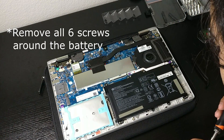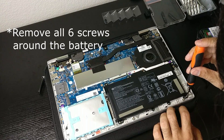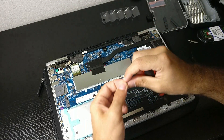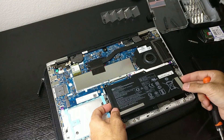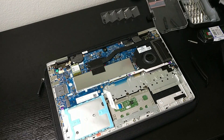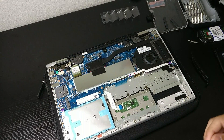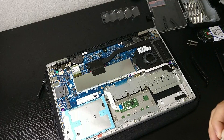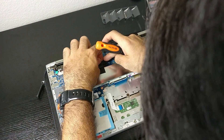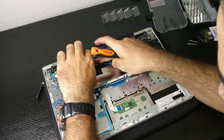We're going to start by taking the battery off. We need a smaller screw bit. We got all the screws out. Now we can pull the battery out very carefully. This is the battery — normal battery. Now let's go ahead and install the new SODIMM module. We're going to very carefully peel this black tape back, making sure that we don't pull or damage the heat pipe. Super important — don't damage the heat pipe.